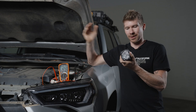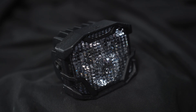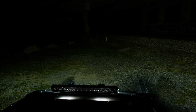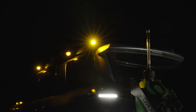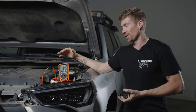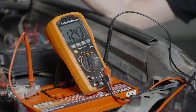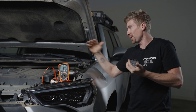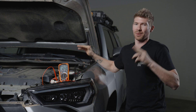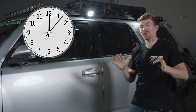The goal is simply not to kill the battery, and we're going to install two of these — the Morimoto four banger, an off-road pod light and one of the brightest in the world. Two of these is pretty common on the side of a vehicle if you're going to illuminate an area. I've got a voltmeter attached to the first car battery. We're going to test until it drops below 10.5 volts — at that point it's going to be very difficult to start your vehicle. So that's the benchmark. With the pod lights on, the timer now starts.